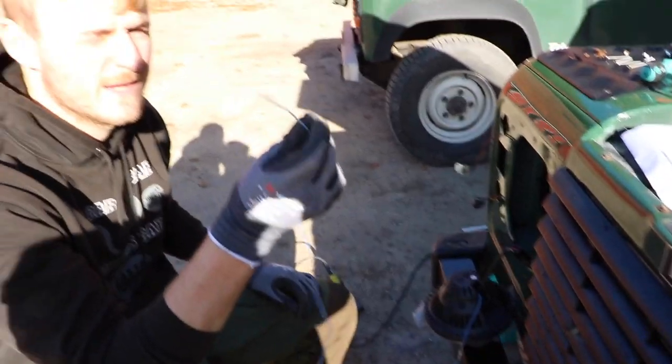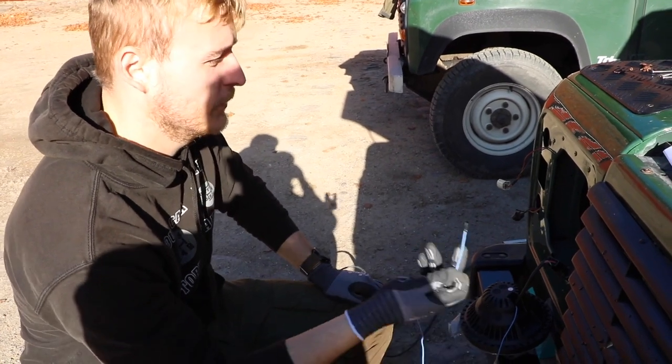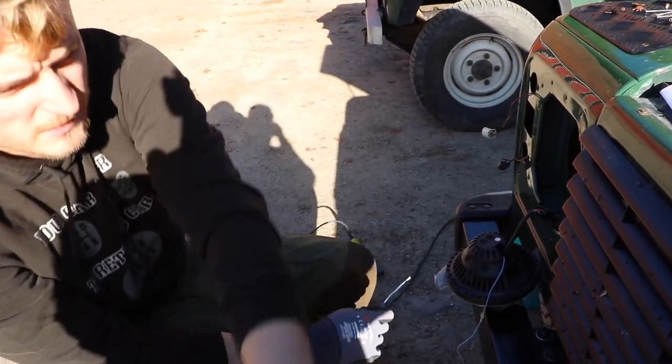We found that the blue wire here is for the daytime running light. These lights do not have the orange ring for the turn signal, otherwise it would be two, and now we only have one. I'm remembering back how we put on the other lights. We had a piggyback wire going across here to each one.